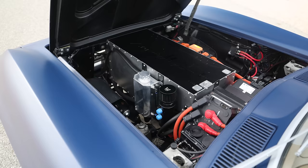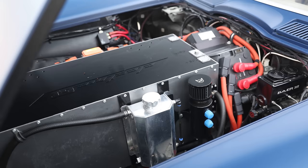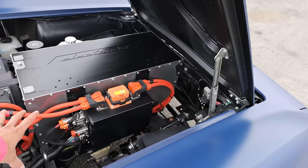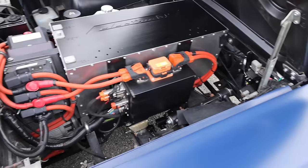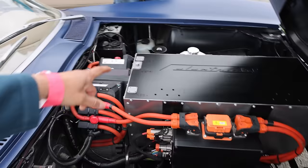This build is also non-intrusive — it's using the factory motor mounts on the front. It's replacing the engine with something of similar weight, placed right in that location. If you were to cut the floor or modify structurally, you wouldn't be able to return it to stock. This one has a couple holes for bracketry, but everything is reversible, keeping the chassis in the spirit of future flexibility.